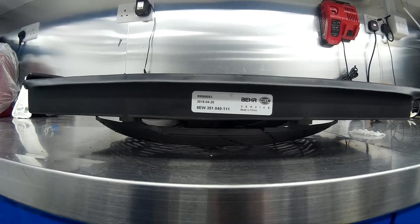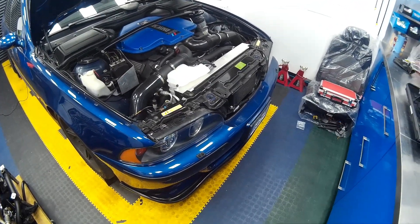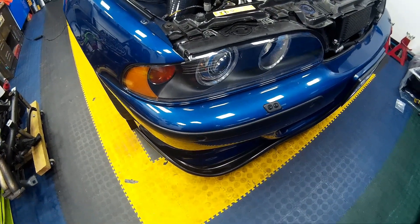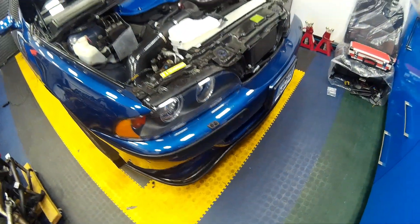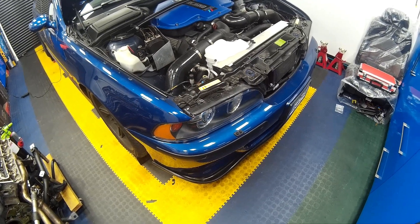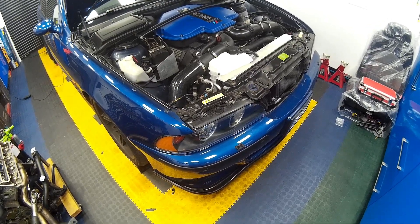For the fitting side of it, you're going to have to remove the front bumper. If you've seen some of my other videos, we've gone through how to remove a front bumper — it's essentially the mounting lugs at the side underneath the plastic under-bumper trims, then a couple of T-50 Torx bolts underneath the front bumper. I won't show you mine fully as I've got additional security measures in place, since the M5 sport front bumpers are readily stolen because they're just that easy to steal.